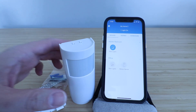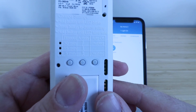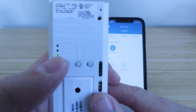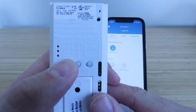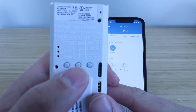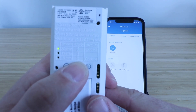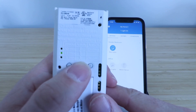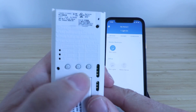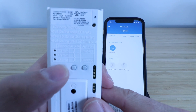There are a couple of different elements in terms of how you can control this and adjust the sensitivity. On the back side you've got three different settings: timeout, activity, and auto-on. To adjust the timeout — which is anywhere from 5 to 30 minutes — you click the button, hold until it blinks, make your selection, then hold again until the LED turns solid. For activity you can adjust from low, medium, or high — hold until it blinks, select your level, then hold again to confirm. You adjust the auto-on setting the same way.